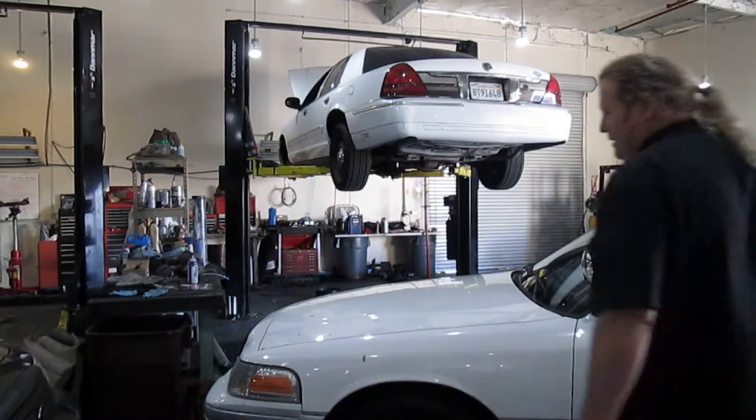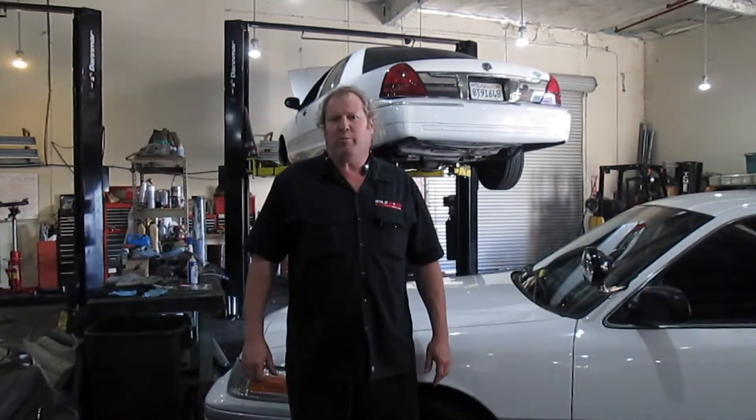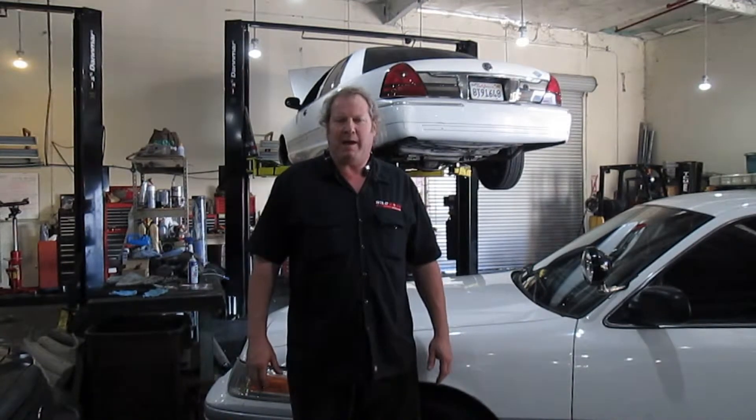Thanks Eric. As Eric said we're involved in several forums to help fleet managers and departments with costs and upgrades on the vehicles, and Rex brought up a very good question. With the Crown Victorias they used to have a vibration at high speed. We fixed that problem in several ways. We actually upgraded the drive shafts and balanced them, as well as upgraded the universal joints, and we've also fitted high-performance heavy-duty rear track bars on these vehicles.